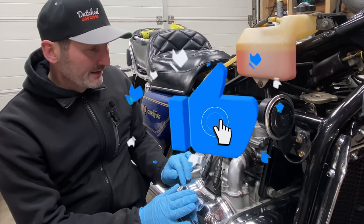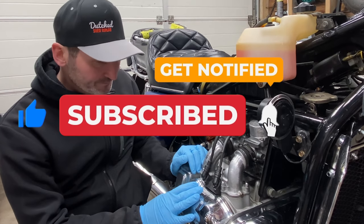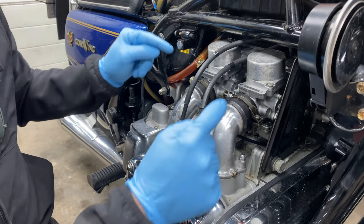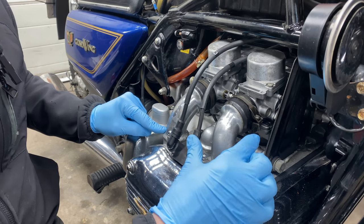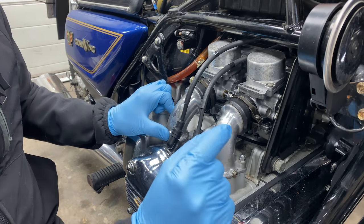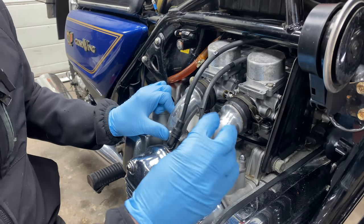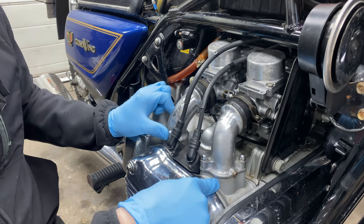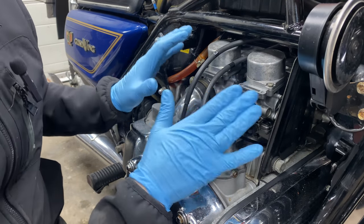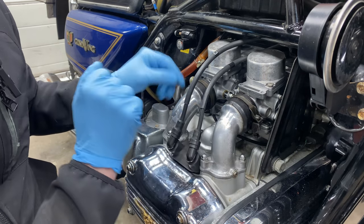You don't need a lot of tools, you just need some patience, and yeah, dive into it. There are a few things that will need to get loose. There are these intake boots over here - we've got two bolts here which need to be removed. Now it's crucial: underneath here is an o-ring. As soon as you take these off, make sure the o-ring doesn't disappear into the engine. Also, if this carb hasn't been taken off for a long time, use PB Blaster or WD-40 to do some sort of lubing.